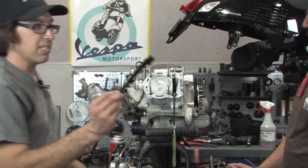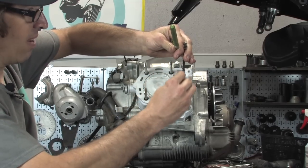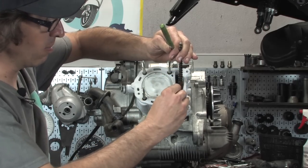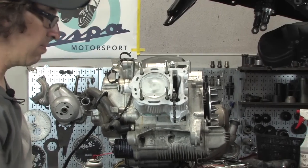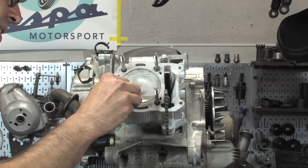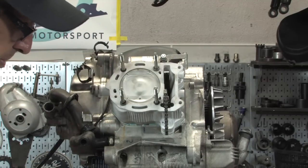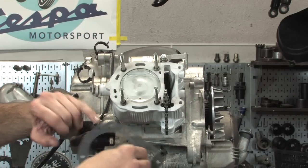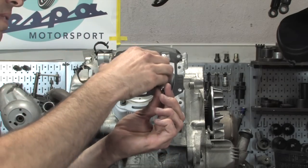Next, you want to put the cam chain tensioner. Don't want to forget this part. It actually drops down, and this little peg catches a little groove in the bottom. It only goes in one way. And now it's sitting in that little well. Got your two dowels. Just drop those guys in. Is there a top or a bottom to those dowels, or are they the same? No, they're the same. So no big deal. And then your head gasket's perfectly clean. See that little oil control hole? Oil hole's down here, so it only goes on in one direction.